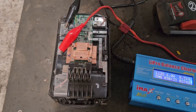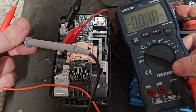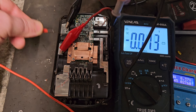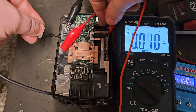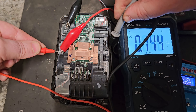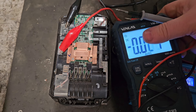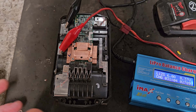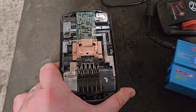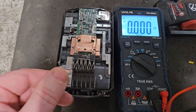It's been half an hour since we last filmed - forgive the rain noise in the background. I think we've got there - we've got one row to go still charging. We're near enough there - 4.05 in that bank. And if we change this round we've got 4.02 in the other. I think we might have done enough. I'll stop the charger, take it off, put that to one side, and take the multimeter back in to see what we're getting in the real world at the top.